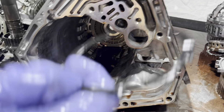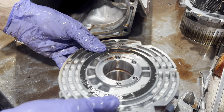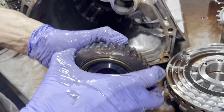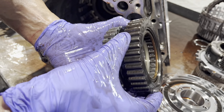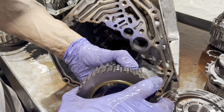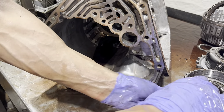We also have a little metal washer that's going to sit right here. So we have a clutch hub and a sprag — a sprag lets it turn in one direction and lock in the other. And you also have another washer under there and a bearing here.